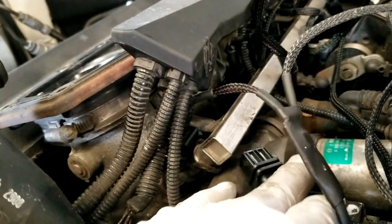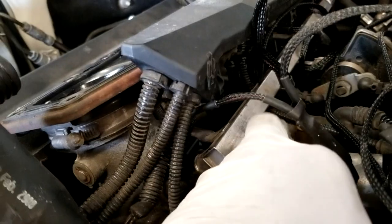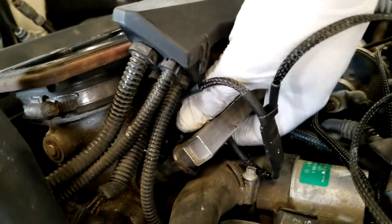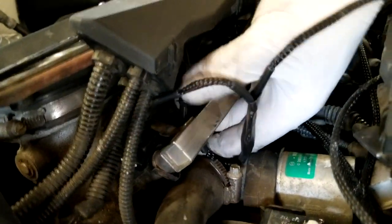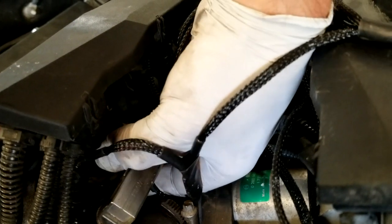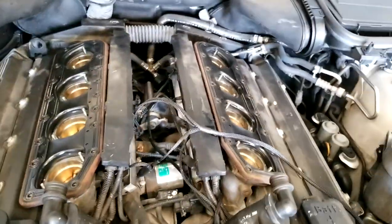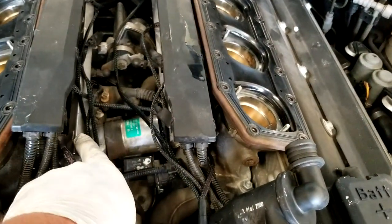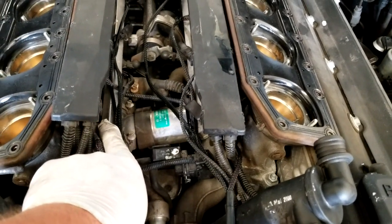I found a good way to keep the wires from tangling up on everything is to run your male plug underneath the fuel rail — that'll keep it away from the linkage and the throttle bodies. Go ahead and get your connector up in there and get it to click in. As mentioned, you're going to have to secure all these wires really neatly and away from that throttle linkage — probably zip tie them all really well right to the fuel rails so they don't interfere.